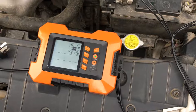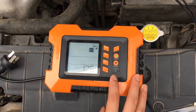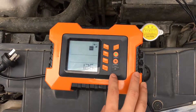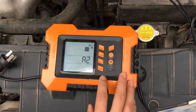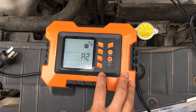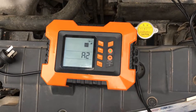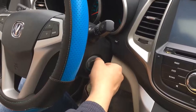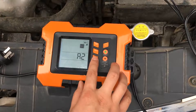The second function is battery start power. Press set — the LCD shows A1 and shows the battery's voltage. Press set again. If the battery's voltage is too low, it is really useless and you need to charge the battery first. When A2 appears, start the engine.